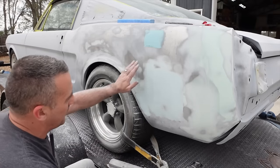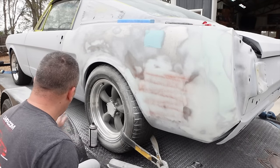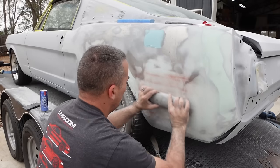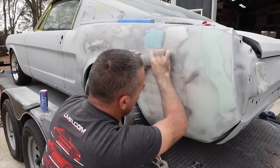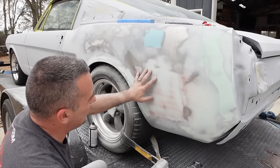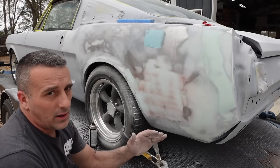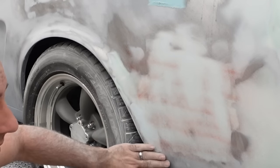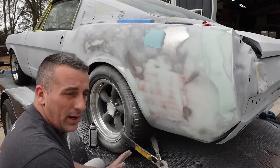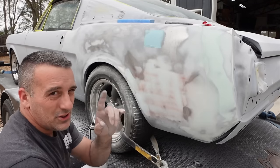Now most of these edges are blended out pretty good and I can focus on the center. Back to interior dye as guide coat. Already you can start to see high and low spots. What you want to do is keep sanding until you get down to where it's all one color, going in as long a pattern as you can. I have to be careful — I can't come across too far or I'll dig into this area, so it's a tricky spot. I can come back this way pretty much as far as I want to, but not the other, so you have to feel the panel out.